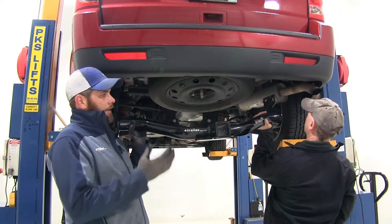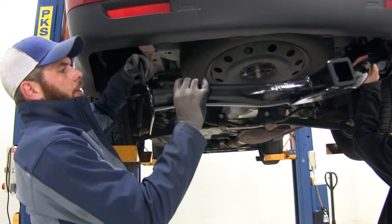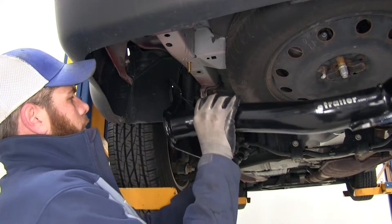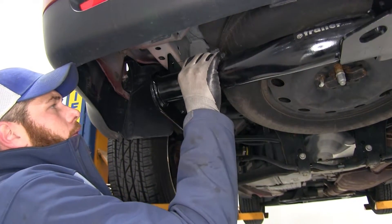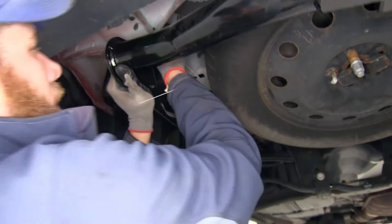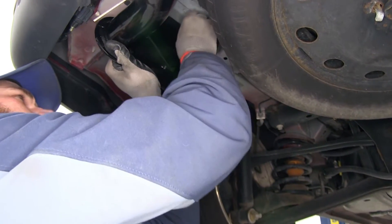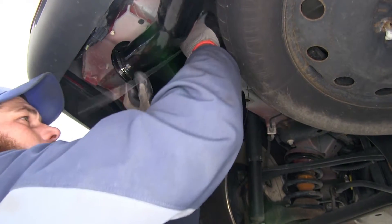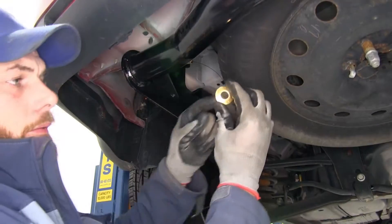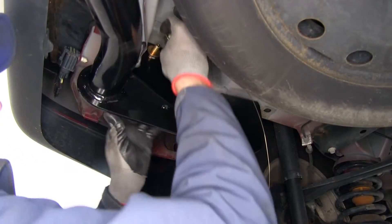With the help of an extra set of hands, we're going to lift our hitch up into position. Remember we talked about placing our pull wires through the side bracket — we raise it up, just being sure we don't press the bolts that are up here back into the frame. Then we take our bolts attached to our pull wires and bring those out of the hole locations, and it'll actually rest there while we get our hardware and put our nuts in place. You can see our conical teeth washer — the little teeth want to face toward our hitch. Thread on that hex nut.